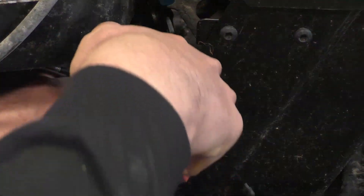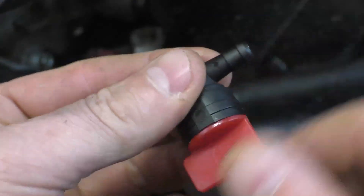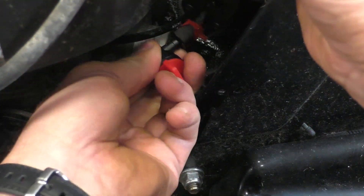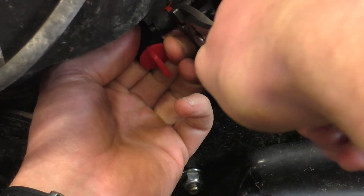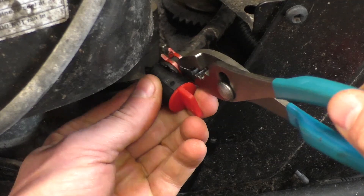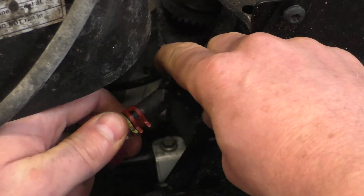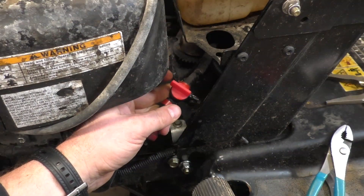I'm going to cut the fuel line about an inch past the filter — you'll see a few drops of fuel leak; that's normal. Now I'll install one of the fuel clamps by sliding it on the fuel line about an inch, making sure the arrow is pointing toward the carburetor. When the switch is turned up, it is in the off position. Get the valve on there as soon as you can, then remove the pliers pinching the fuel line. Bring the clamp back and get the valve all the way in, positioning the clamp right where the fuel valve connects. Put the other clamp at the other end of the fuel line, reattach that side onto the valve, and squeeze the clamp back on. That's all there is to it — fuel valve is off in this position.